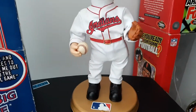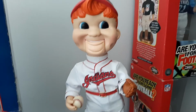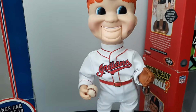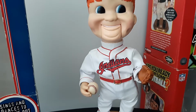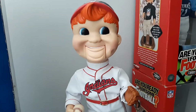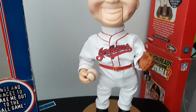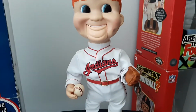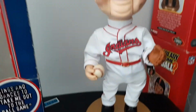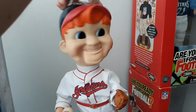And then as time went on, while I had this thing, if you guys noticed, the gears for the head were extremely loud. It sounded like the gear was splitting, but yet there was no grease in the gearbox, and the grease was dried up, but the gear was also kind of splitting. So I found a head mechanism with gears in it, and I decided to swap out the parts, and this is what the head sounds like now. See, it sounds gorgeous, and it also turns really well too.